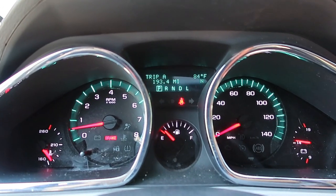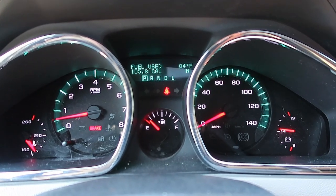Get her back on her trips — trip B is set. Oil change complete. The computer has been reset and won't bug us when it actually hits zero. So if you have a problem where it's flashing 'oil change,' press the little car with the eye icon until you get to oil life remaining and hold the checkmark. Just sit there and hold it — it'll act like it's not doing anything, and all of a sudden it'll go to 99 and then 100 and you'll have 100% oil life remaining. Oil change has been done — check that off the list.